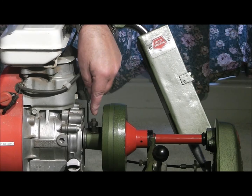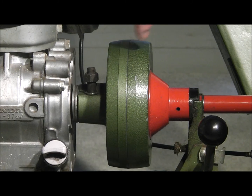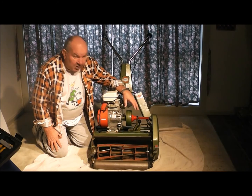If you have a look just down at the captive cotter pin here, you'll see that the captive cotter pin is not very captive. In fact it's protruding probably almost up to half an inch. So we need to go in and investigate what's happening inside here, and we're hoping that there's not going to be any damage to the engine shaft.